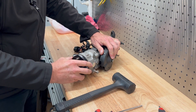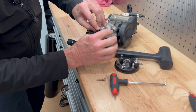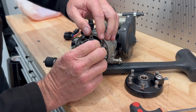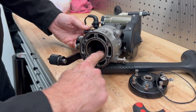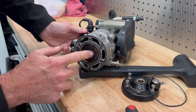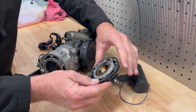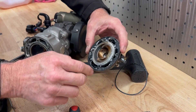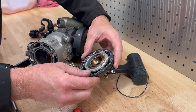Alright, check it out — there we go. The o-ring has popped through and you can see the corrosion build-up around it — I might be able to save that. The cylinder itself is not too badly corroded and there's not a lot of carbon on there, so this board hasn't had a lot of use. Looking at the head, through that fitting it's really badly blocked up — there's some corrosion build-up but not too bad. We need to get that fitting out, so we'll get some heat into it and try to clear that out.